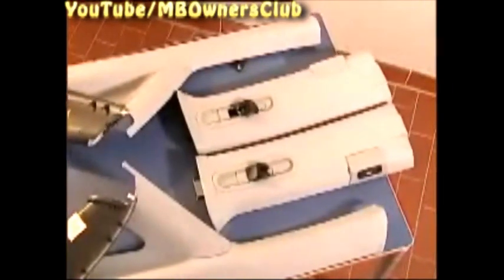Here an overview of all parts which have been removed from the front of the vehicle. The control device roof operating unit, the hold handles, the sun visors, the lights of the cosmetic mirrors, the holders of the sun visors, and the panelings of the A as well as B pillars.